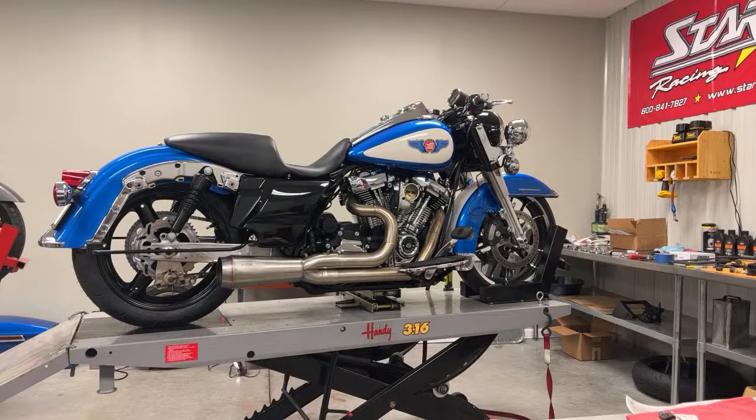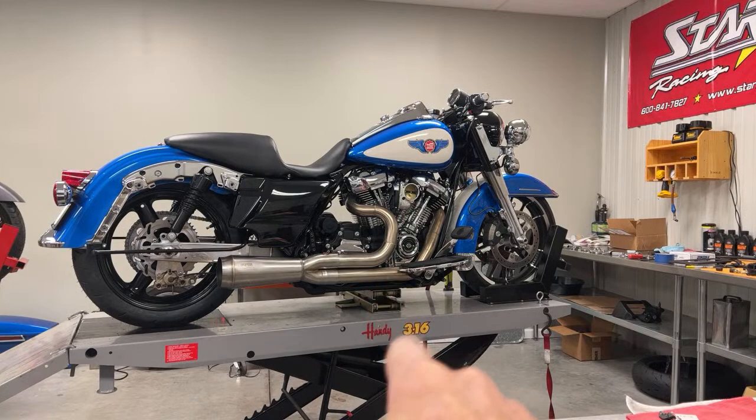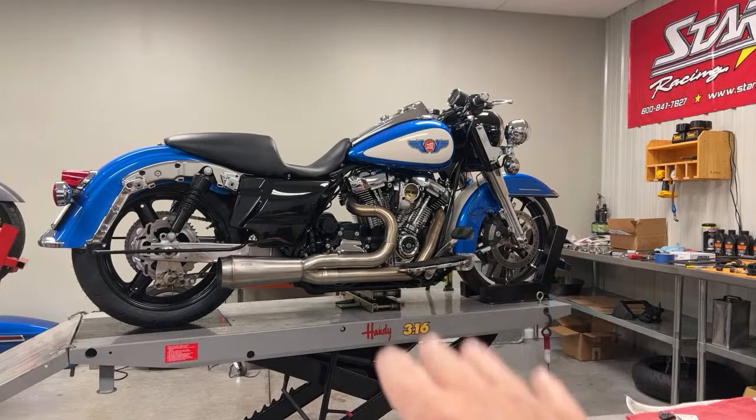And then other people would come in all the time that were having sumping issues, and no one really understood what it was, but it was definitely running hot. You could definitely see where it was starving for oil. But when you would cut the drain plug loose under the sump, under the crankcase here, a couple of quarts would come out, and you say, well, how can that run hot if it's got a couple of quarts up there? Because this is not a